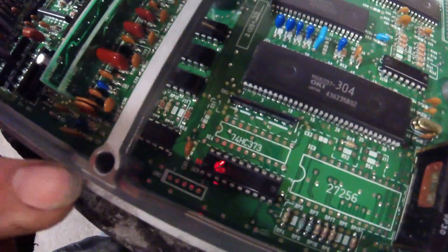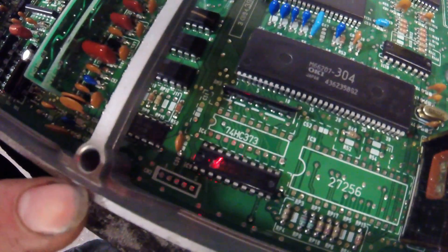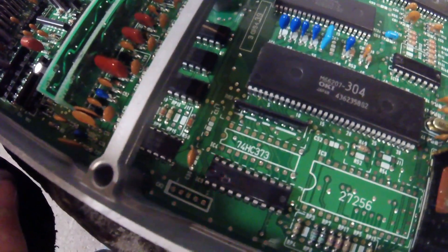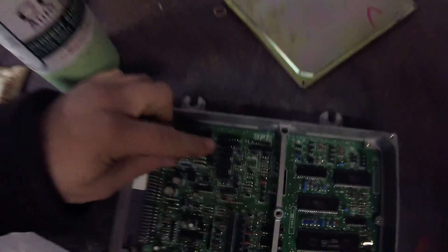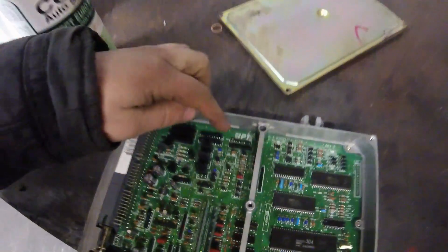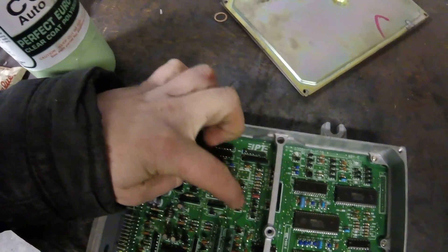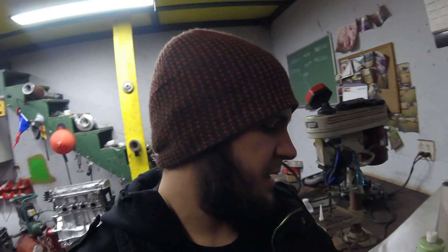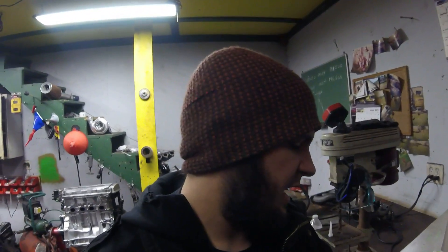The CN2 port on the bottom has five solder joints. You desolder the first four — slots one through four — and install your data logging header there. A P28 already has VTEC, including the VTEC switch at IC14 and a C60 capacitor with the necessary resistors. We'll do a VTEC conversion video in the future, but for now I'm showing you a basic chipping process.